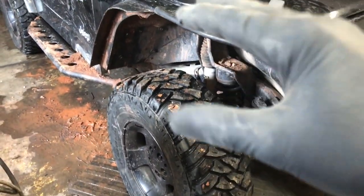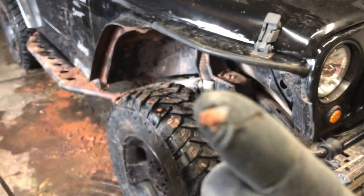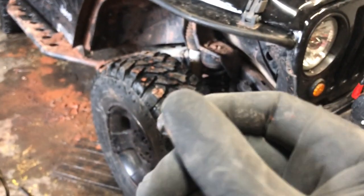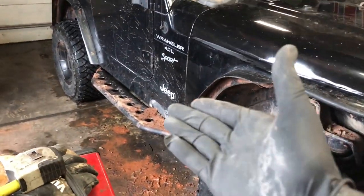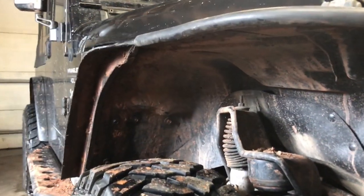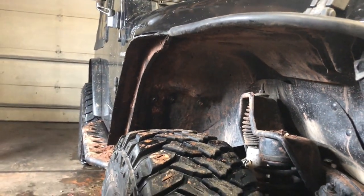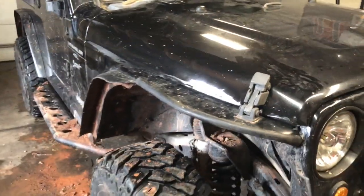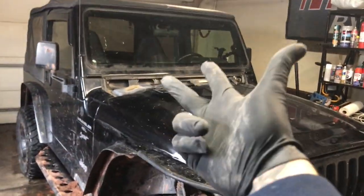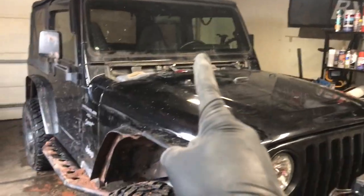And there you go — highline fenders. You get almost three and three-quarter inches of clearance without doing a three-and-a-half-inch body lift, without having to touch the body or the suspension. You get almost three inches of clearance in the front. I already have a two-inch lift, so figure two inches less than that for stock ride height. The hood turned out pretty good — there's more room now and just a little bit of a gap. If you like this, subscribe if you want to see more, and as always, keep on modding.